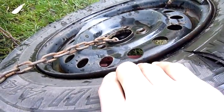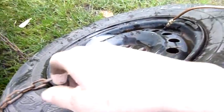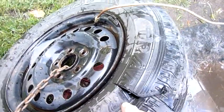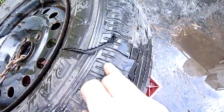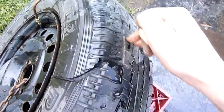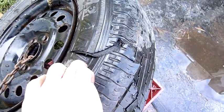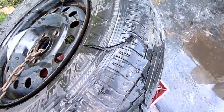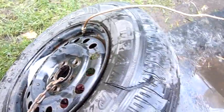The bead's actually coming off — the bead wire anyway, it's not very tight anymore, it's pretty stretched. That failure probably would have occurred anyway if this tyre had had a puncture repair, but upon inspection I couldn't see any obvious signs of a plug or anything like that, so I'd say this had never had a puncture until now, and that was the point of failure. Interesting.